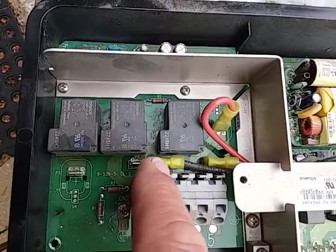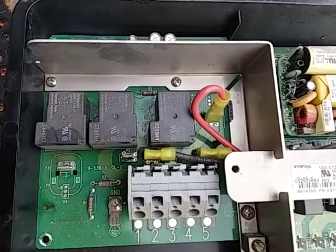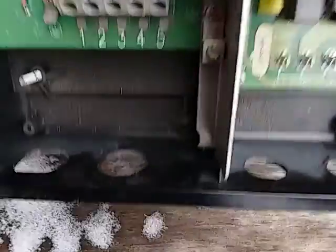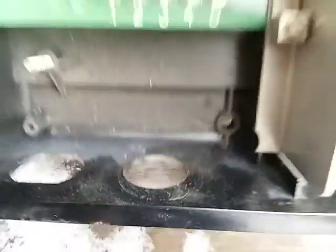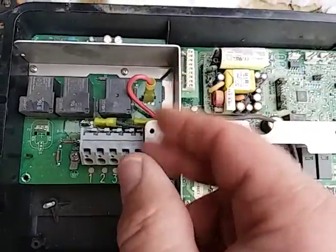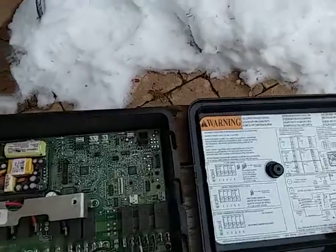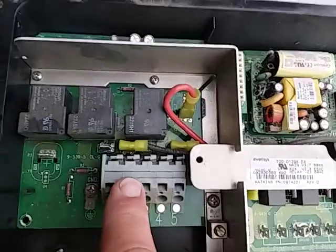Focusing on the relay board — look for some black soot and black scorching on the green circuit board around and in between the relays. If you see some black soot in there, that's probably an indication of a bad board. That'll also probably coincide with a few white dots and white streaks, and a couple of little solder blobs that rolled around when the back side of this circuit board blew out its solder. Mine had a little bit of soot and I could smell a little burnt electrical — the back side of the board blew.